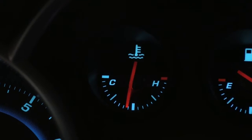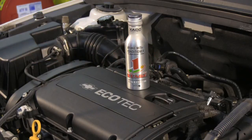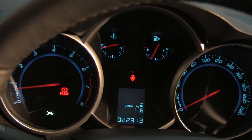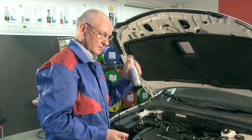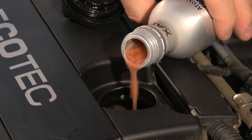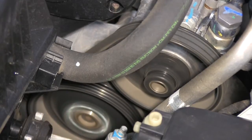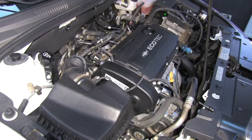The engine should be warmed up to operating temperature. The compound should also be warmed up before application under low temperatures. The easiest way to do this is to place the bottle on the pre-warmed engine. Then shake the contents of the bottle thoroughly and introduce it into the oil filler. Let the engine idle for 3–5 minutes.